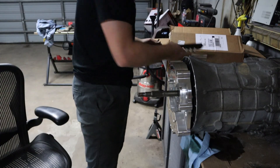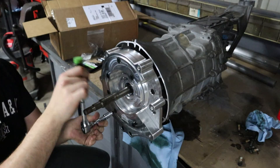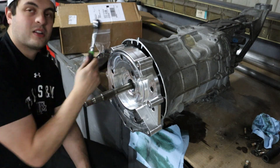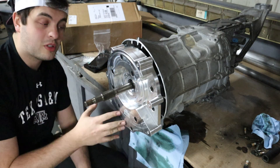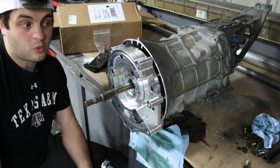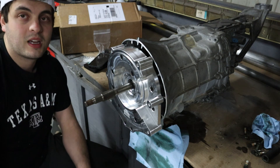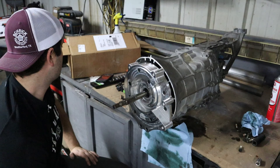For anyone using this kit, it uses a number-5 hex head. I spent about 45 minutes sorting out the torquing because I originally hand-tightened everything and noticed a huge gap on the bottom while the top was tight. The fix was simple: 30 foot-pounds is the spec, and you have to use the star method when torquing them down — that way it goes on flush, just as designed. I was just being an idiot.